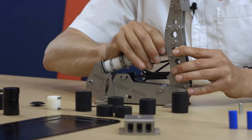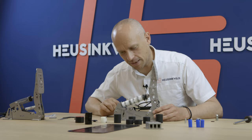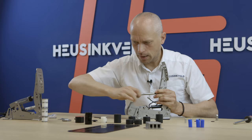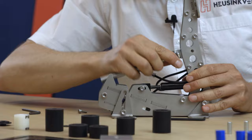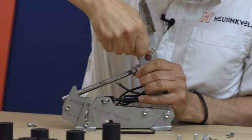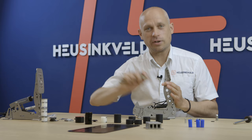Again, remove all of the preload — it won't be much, but you want the stack to be as loose as possible. Now another trick: if the rod end doesn't quite budge, you can loosen these bolts to help a little bit. This one is kind of stuck, so I'm going to release this bolt just a little, this one as well — you don't have to take it out. And then the rod end slides out with ease. Just don't forget to re-tighten them when you're done.